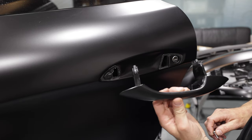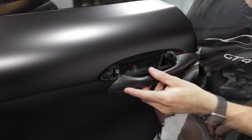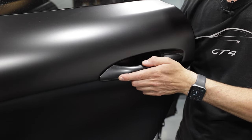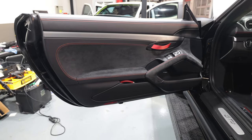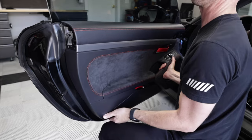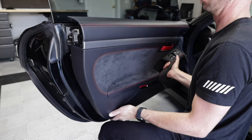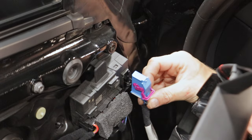The door handle is mounted with just these two prongs, and they each have a screw that goes into them. To remove these two screws, you do have to remove the interior door panel. It's one of the easiest panels I've ever removed off a car — only held on with four T30 screws, which happens to be the same type of screws that hold the door handle on. The procedure is pretty easy, but I can walk you through it in my other video. There should be a link at the top right corner of your screen or down in the description.